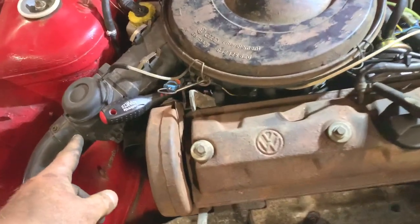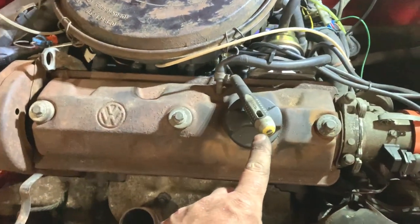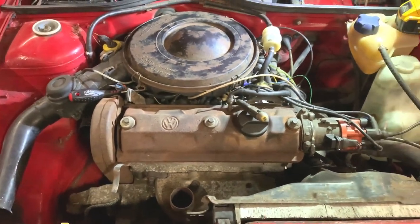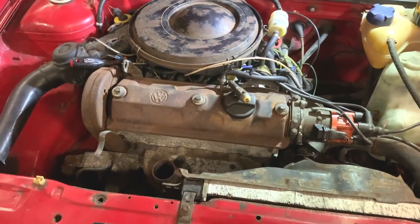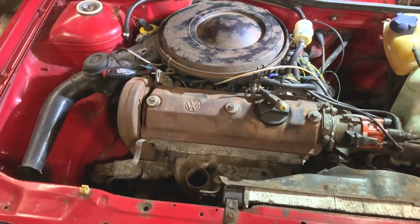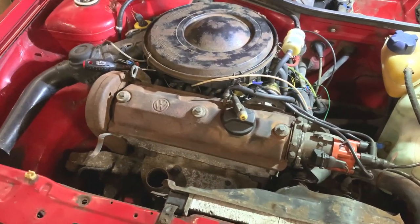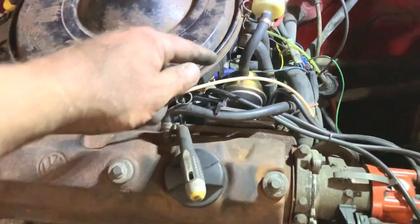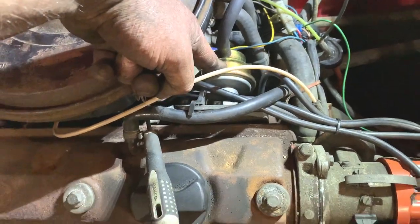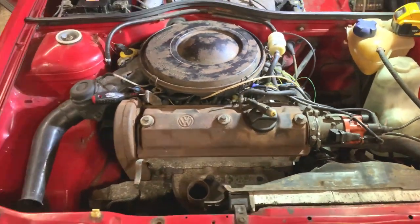But I've still got a screwdriver in there because there's an adjustment screw in there and there's one in there. But I don't think I can do too much more to it until I've sorted that exhaust leak out, because that is making it sound like it's running lumpy. And actually before, it was running lumpy. I couldn't understand. It kept stalling and was running lumpy. When I put the new fuel pump on, I forgot to put the plug lead back on. So yeah, schoolboy error there.